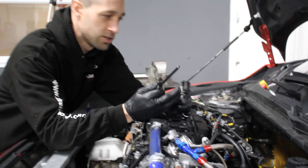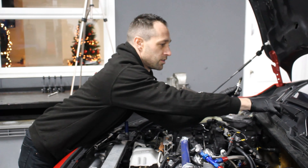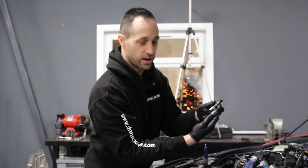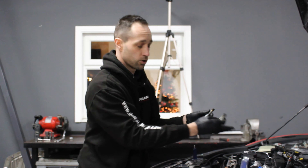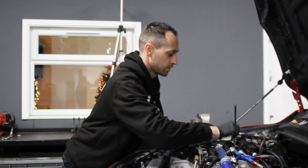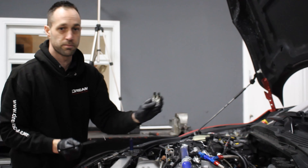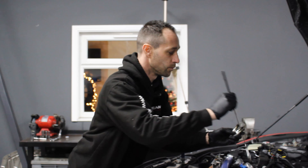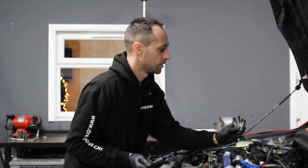So that tells us something there straight away. This spark plug - you can see it's wet there, just compared to number one. You'll see that this tip's all nice and dry, but this one's wet. That's a pretty surefire sign that we've got a coolant leak into number two. I'll just pull number three out and see if that's any different. Number three back to how we're looking on number one. And number four is probably looking the same - yep.